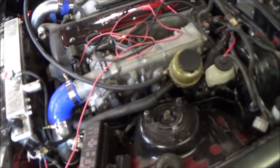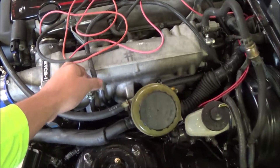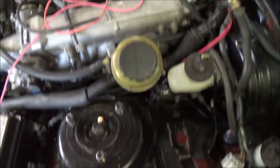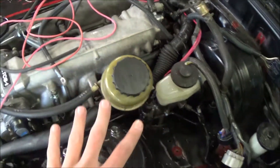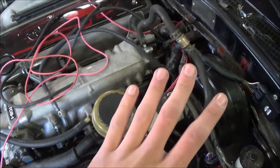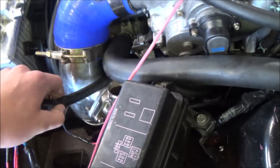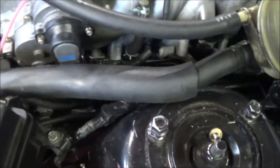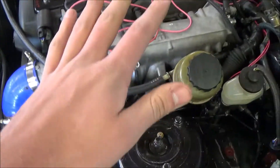That is 95% of what you need to wire up the engine — there are just a few more things to go over and then we'll be completely done. First, this wire right here is a ground that comes from the engine block to the body. I have it grounded right here — it just swings across, and all you need to do is have that grounded onto the body. There is also an alternator wire that comes out on this side — mine came cut. It's a super thick, like one-gauge wire that's black and blue, and all you do is wire it up to the positive terminal. And lastly, you have this black wire that goes from the negative terminal and goes onto the body for the body-to-block ground.